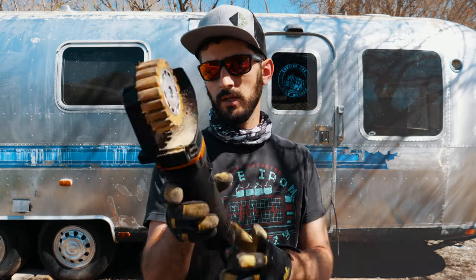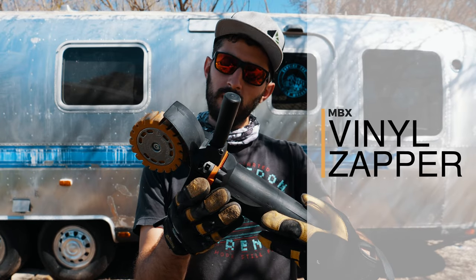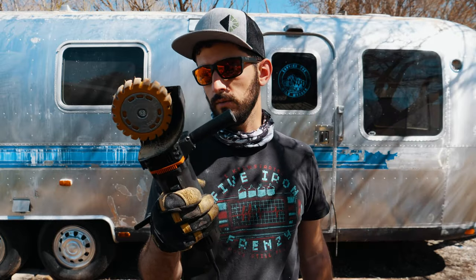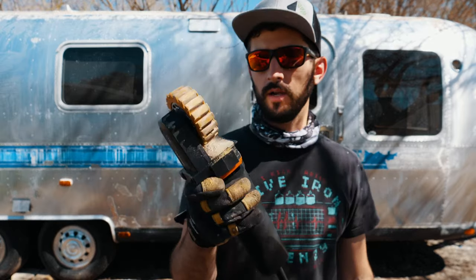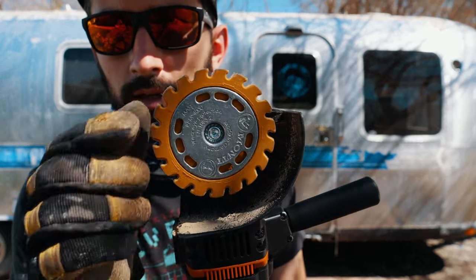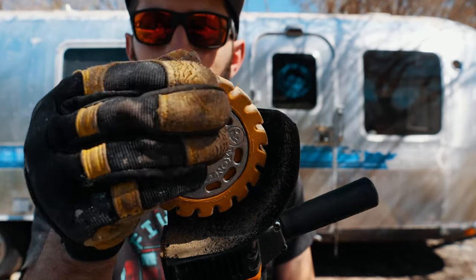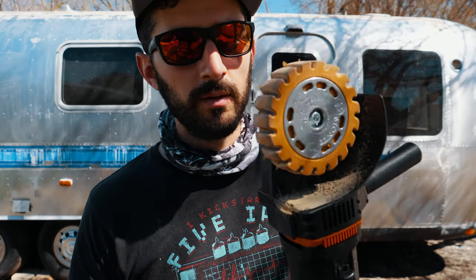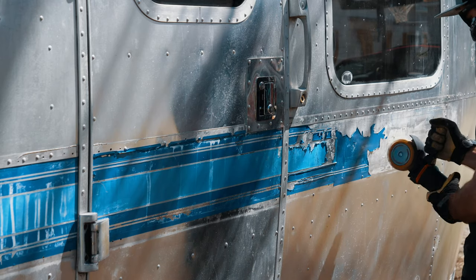I asked my friend Fred, who I used to work with at the decal shop, about removing this. He told me they got this new tool — I have it here, I'm borrowing it from them. Not sure what it's called, but it's made by Monty, a German company. I'll put a link to it in the description. Basically it's just a high-RPM wheel with a little wheel on it that's kind of got teeth — it's basically a hard rubber, kind of like an eraser but a lot harder. I'm going to give it a try and see if it helps take it off. Supposedly it works really well and saves a lot of time, which I really need because that vinyl is not wanting to come off.